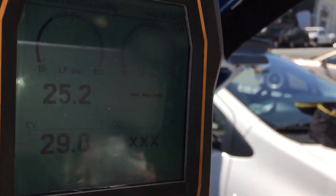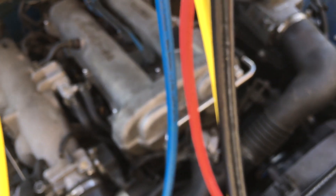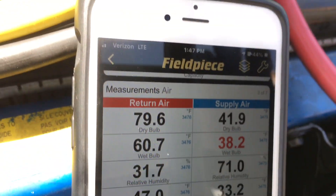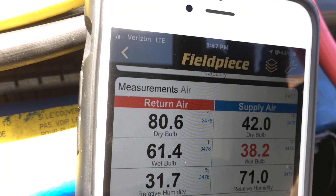The sun is directly in my eyes but there we go — that's the low side pressure dropping. So on a fixed speed compressor, revving the engine actually makes a difference. On a variable displacement compressor, you're out of luck. We're getting 42 to 41 degrees coming out of the dash.